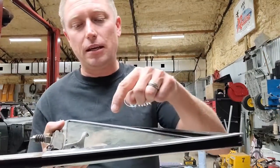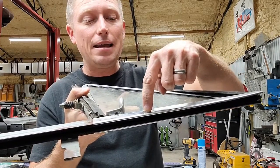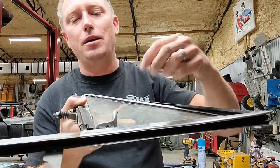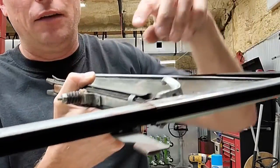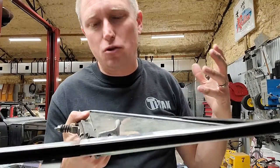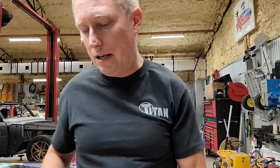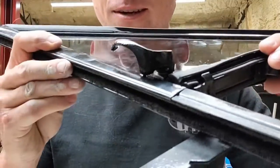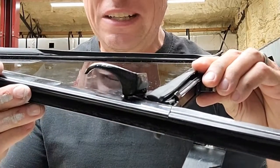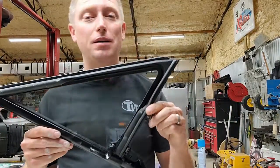One last thing that I want to share with you as well. Powder coating is thick, so when you go to powder coat something like that stainless steel trim right there, you got to realize that you're adding surface area to these really, really tight seams like that right there. So if you're going to shoot powder on this stuff, try your best to shoot as little of it as possible, because once you blast it down, and then you coat it in powder, you will find that as you're trying to slide it in place, as you can see I have done right there, it is really, really tight. So I recommend putting as little powder on it as you possibly can.